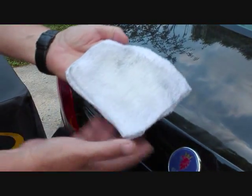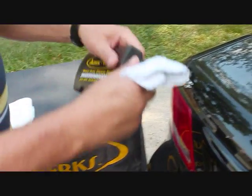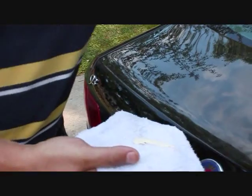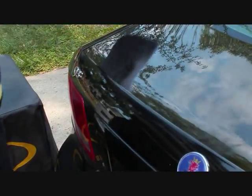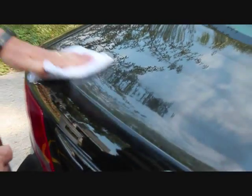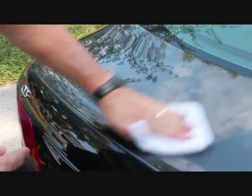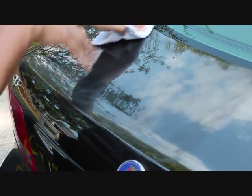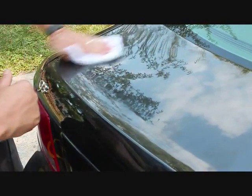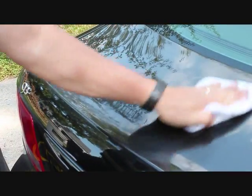And then what you want to do is, as one side loads, flip it over to the clean side. Apply just a little bit more polish. Knock that around, and go ahead and apply. We want to do this process until we get nothing up in our washcloth, but a clean cloth in the end. Use the bridge of your hand for the application versus fingertips, so you're not getting just 4 points of application pressure. You're getting a nice even amount of pressure across the board.